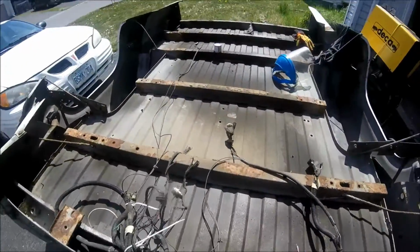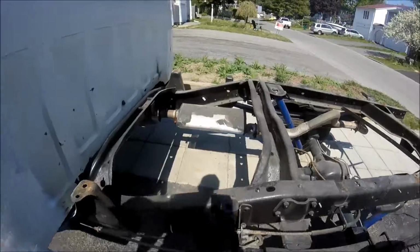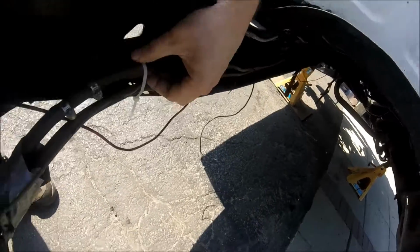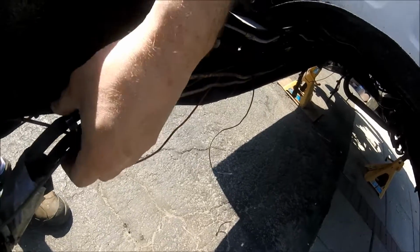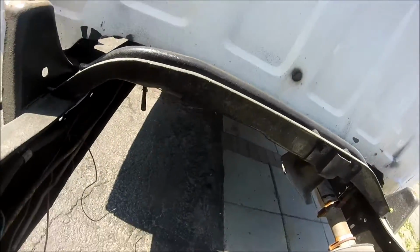After that is done, I'm probably going to work on the truck fuel system. Luckily, this thing came with a replaced tank and a replaced sending unit, so that's something I don't need to replace. I'll paint that and test the sending unit and flash the pump. Get that in there, and then, I don't know if these lines are salvageable. These look like they're crimped on, so I'm unsure what to do with the fuel lines, but I'm definitely going to address them, make sure they're in there nicely and not leaking. I also have an extra fuel filter, so again, just stuff to keep the project going.